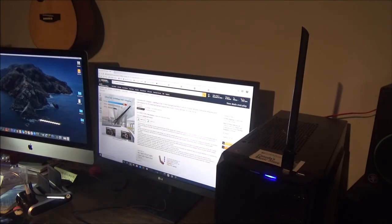So if you're a Mac user, you will need the drivers. Windows 10, no drivers. 8, probably not. 7, Vista, XP, likely going to need the drivers. But they do give you instructions here. Except for one thing they don't realize is with us Mac people, we can read different formats of media. So you can ignore where they say you need a PC laptop to take the drivers off of the CD and put it onto a USB stick, and then you can transfer it to your Mac. You don't need to do that. You just pop it into a CD player, away you go.